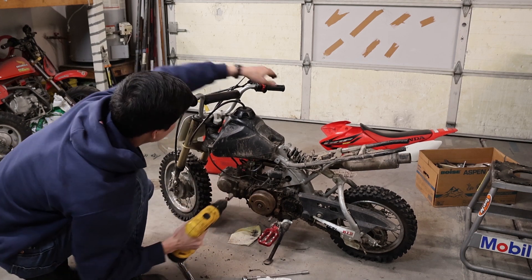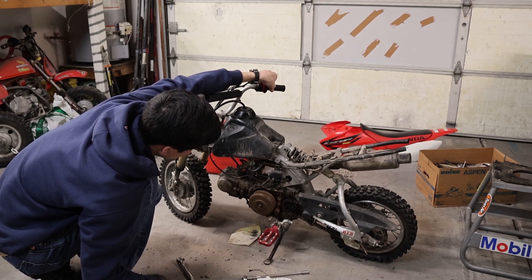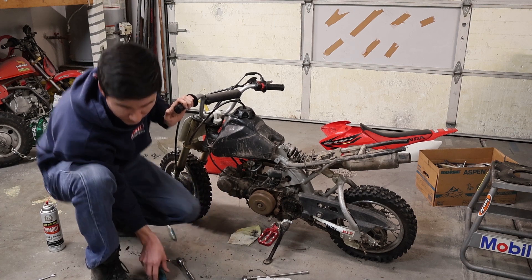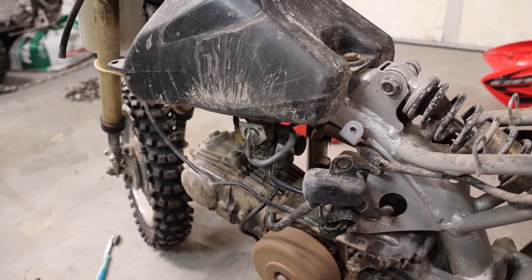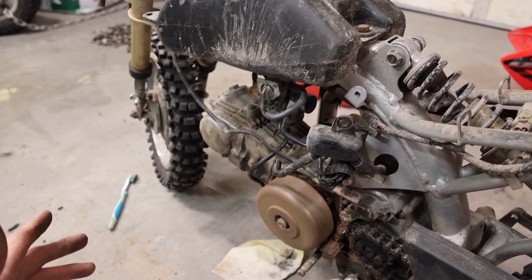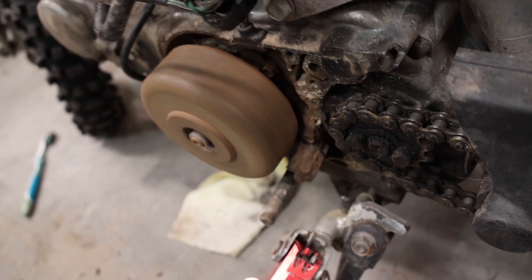Let's try this again. Sweet — didn't even smoke! We don't have the air filter on there so it's not going to run exactly right. I don't want to mess with the carb too much because without the air filter it's kind of a waste of time. Once she got a little bit warm she seems to idle all right — a little bit of lope to it, but that's fine. There's also a super large gap between the flywheel and the pickup, so that's a bit weird.